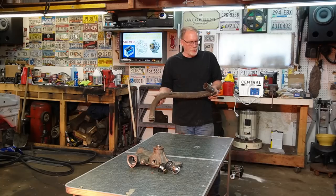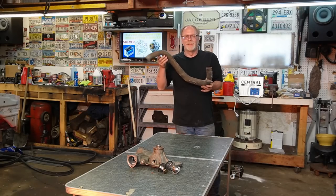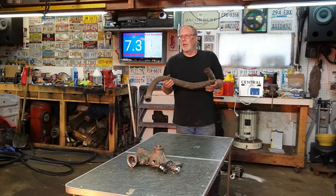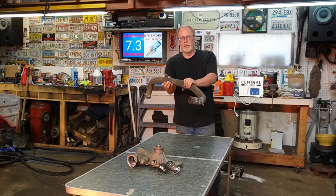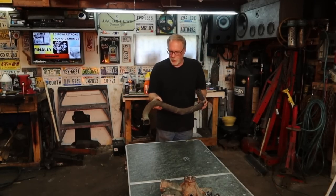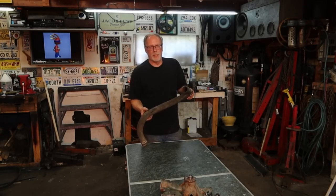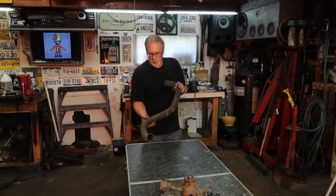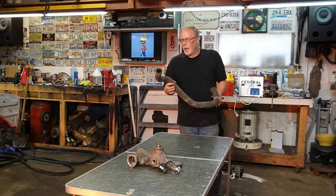When's the last time that you went through and changed your radiator pipes? Easy way to test them, engine cold, just come up here. If it's nice and stiff, yeah, you're good to go. No cracks. Didn't have a fan belt run up against it like this one right here, that dug right in there and caused a hole.